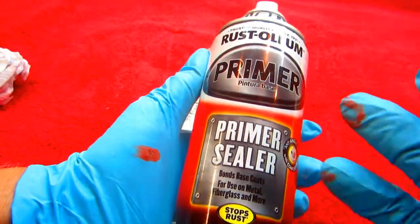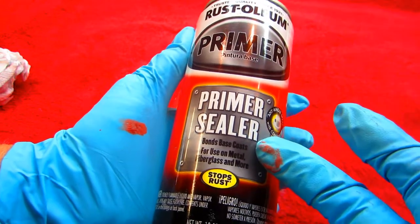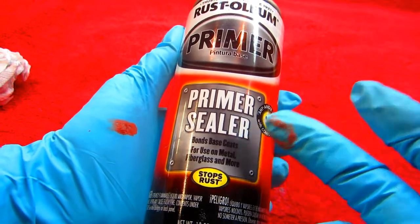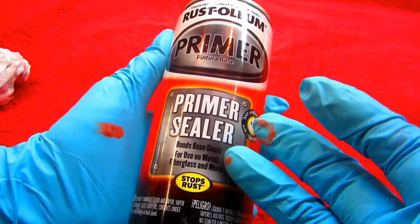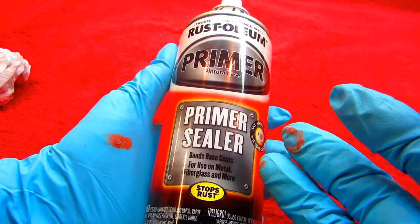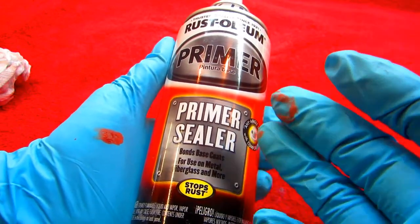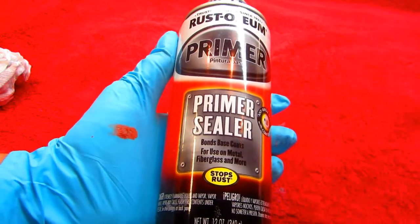Now the material we've been using on this job is primer, but it's primer sealer. Anytime you're dealing with plastic parts that you may be going through into the raw plastic, especially the older parts, and I'm just making an example, a 750 Honda side cover, a Ducati mirror, any of those parts, this really stacks the deck in your favor. You're not going to have a problem.